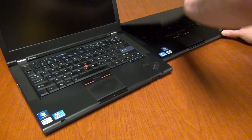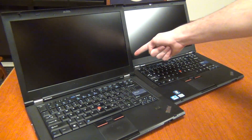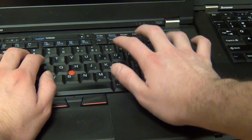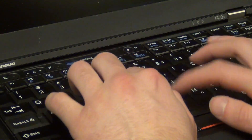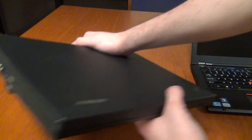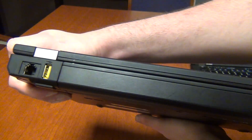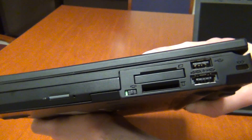Moving on to the T420 and T420s — in terms of design they're fairly similar to their predecessors, but the T420 is a little thinner than the T410. Both have moved to a 16:9 aspect ratio display, with resolutions of 1366x768 or 1600x900. These were the last ThinkPads to use the classic seven-row IBM-style keyboard — the same keyboards as the T410 and T410s, which feel great to type on. The T420's I/O includes four USB ports, ExpressCard, DisplayPort, VGA, always-on USB, an SD card reader, and either FireWire or a 56K modem — not both.